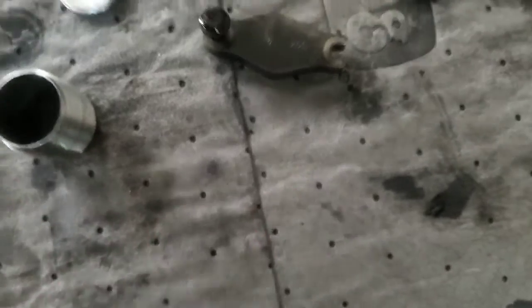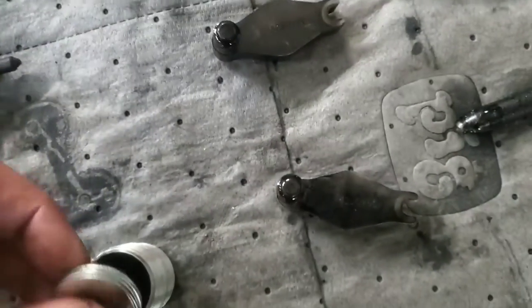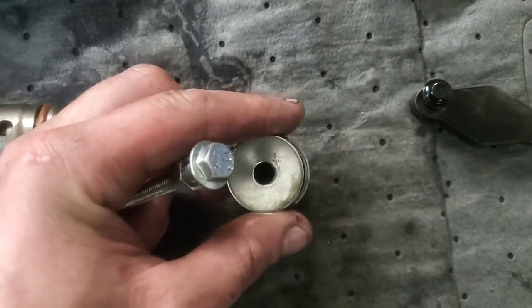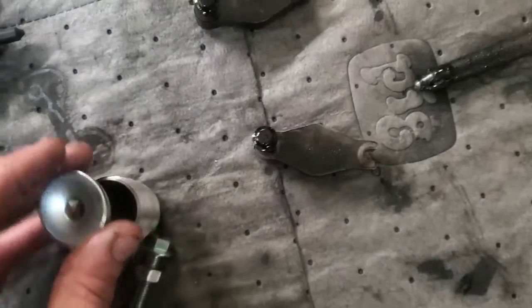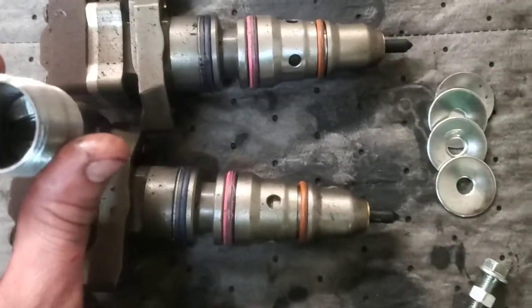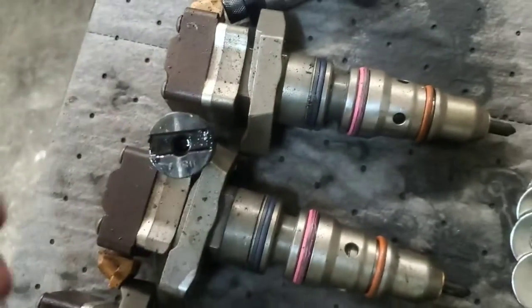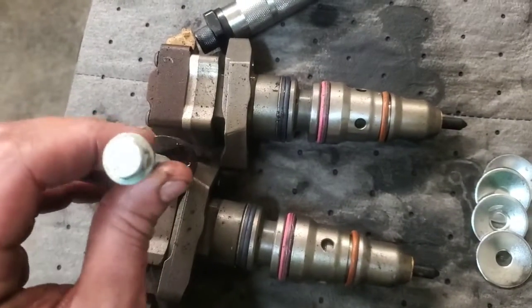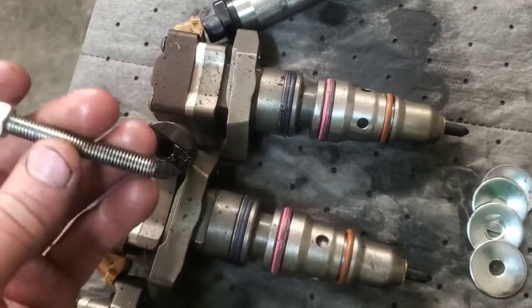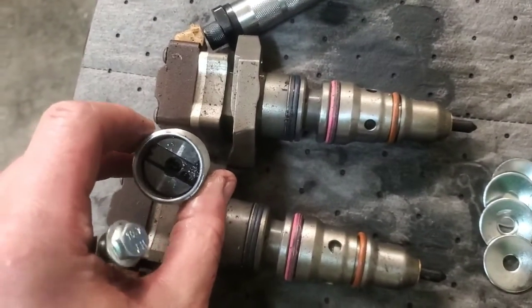Get a nut to match it and run the nut all the way up. I've got some fender washers here - anything would work really, it just needs to be able to cover that opening. You drop this bolt down through there. What this does is the pipe fits perfectly over the injector and fits in around everything else. You thread in this bolt with the tool on there, and as you run the nut down it's pushing down on the pipe and pulling the injector up - that's how we're going to extract them.